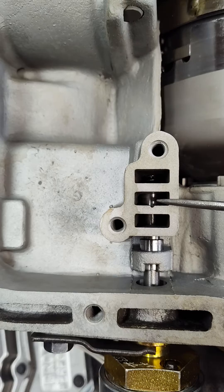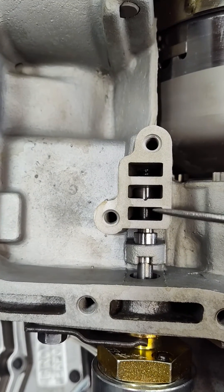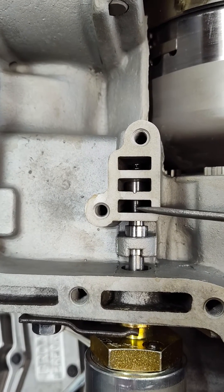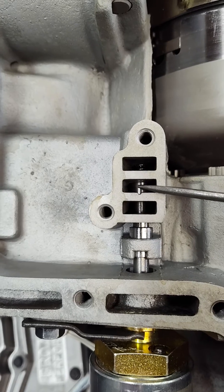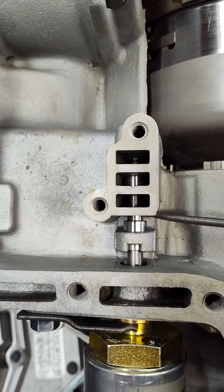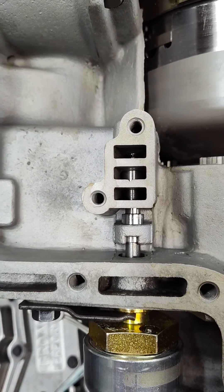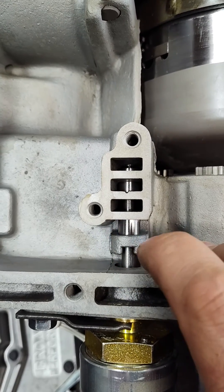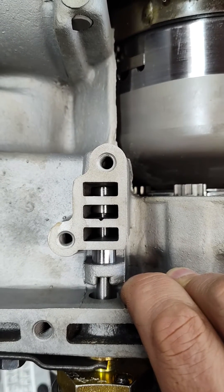What that's doing is connecting this passage with this passage and blocking it here, so oil is transferring between these areas. This is your pilot, and that means this is where the pressure comes in. When the trans brake is in the off position, the pilot oil is trapped in here. This position here is what goes to your direct clutch to make the trans brake come on — sometimes also the low reverse clutch depending on the design. This should be open, so pilot is shut off and this is nicely vented, so anything leaking past here or anywhere in the circuit is easily vented off. This is important so you don't have this thing trying to lock up high gear when you're trying to drive.